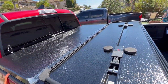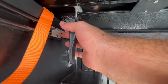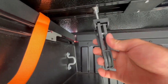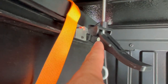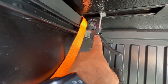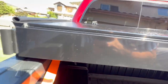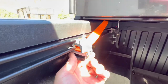Once you finish adjusting it, go ahead and fold it this way and now we will clamp the first sides in place. Bring this to the side and before you tighten this one up, align it as well — this is going to end up clamping it in place. Go ahead and loosen it and get it all the way down and adjust it to size. If you do lose one of these, there is a replacement part that comes with it just in case. After I loosened it I was able to get it clamped in. Once you've found the level of where it's supposed to be, tighten this one in place. This strap right here is going to be basically for backup, so put this on the railing like that and stretch it out, make sure it is tight.